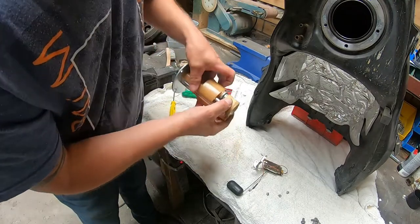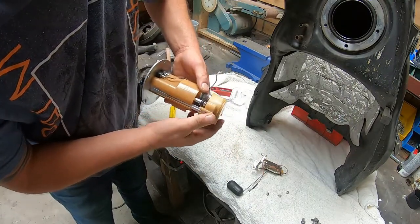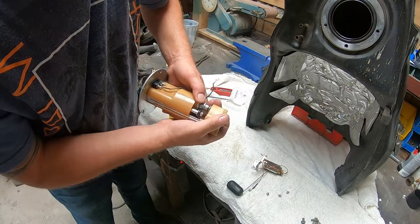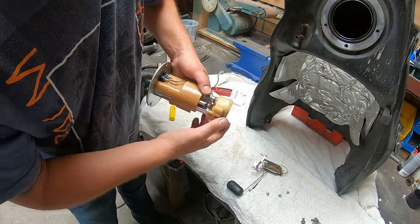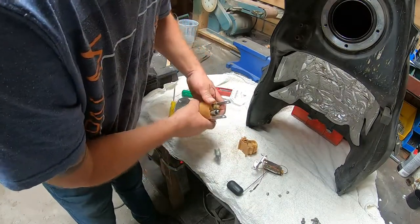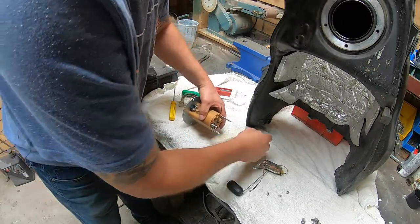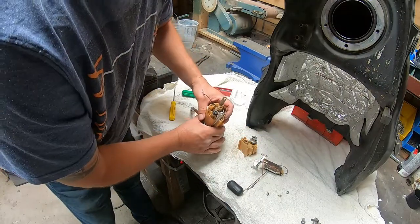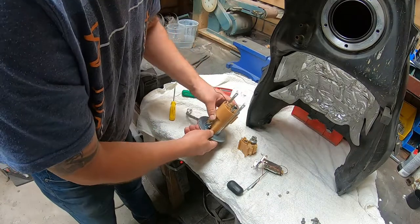Just a little gentle bit of prying and it finally wants to let go. As you can see, it's got a big O-ring there, and another one on that bit — that's what really gets stuck. There's some sort of valve in there, so remember where that goes. The fuel filter is actually right down the bottom here, believe it or not.